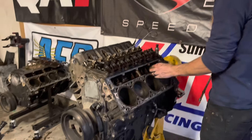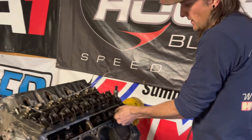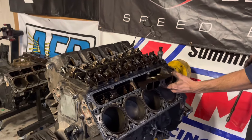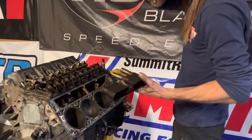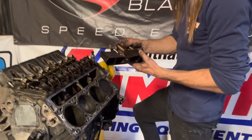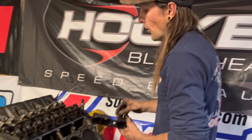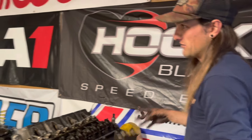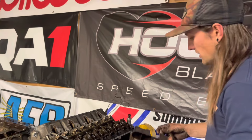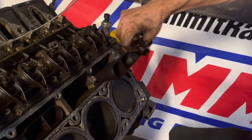Couldn't it have also ended up in the yard for a failed transmission? Yeah, that's pretty common — 4L60s and 65s basically have a 100% failure rate. With the 6-liter half-ton stuff that's what it is every time. But for all the active fuel management stuff it's basically 50-50 — what failed first? Starting in 09 they went to the 6L80, which fails a lot less often, but when it fails it's like five grand — so those really mechanically total the cars, whereas the 4L60s don't really mechanically total unless people just don't want to put money into it.